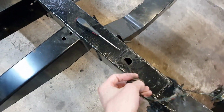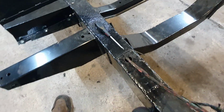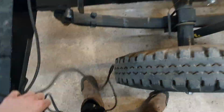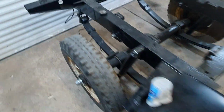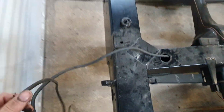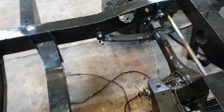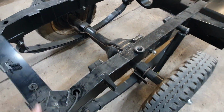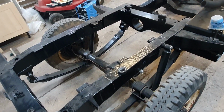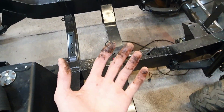So a little grommet just popped out, hence the screwdriver helping it out. So I'm hoping now you can see all this damage from welding. So there we go, brand new cable in the chassis with plenty of slack either end. In fact, I could pull some more through. Something else I'm going to do, I think, is put a 5-pin Bosch style waterproof connector on here to disconnect the back end of the Land Rover. Make it a very easy thing to do. Yeah, next job. Probably got to wash my hands, that might take 20 minutes.